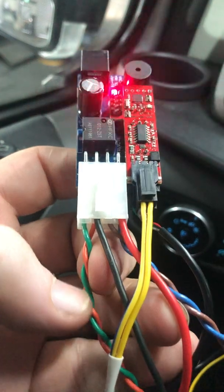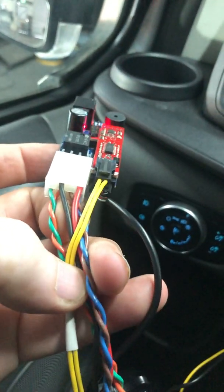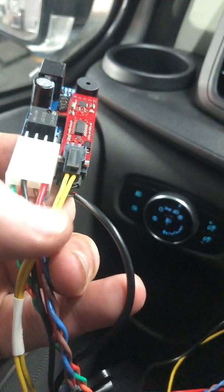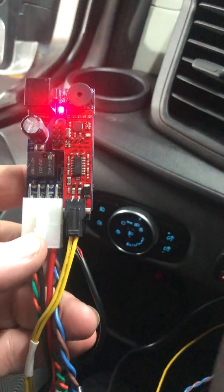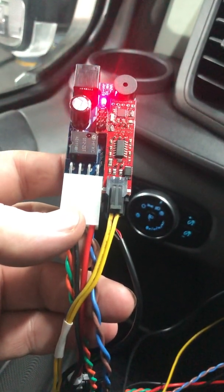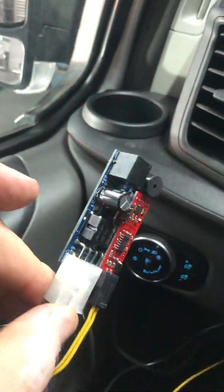This line is going to the body control module. The twisted ones are going to the steering module, and these are the LIN lines which you have to cut, because this car has dual: the LIN for the wipers, CAN for the turn signals, cruise control, and all the rest. So this is a little module, a small box that can do it, manufactured by us.